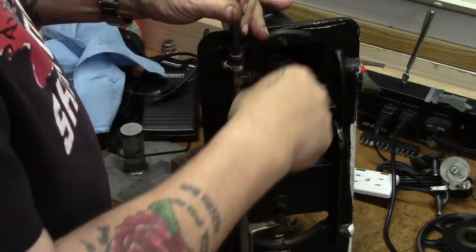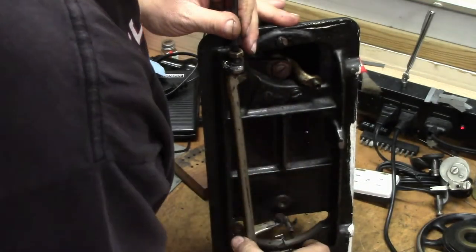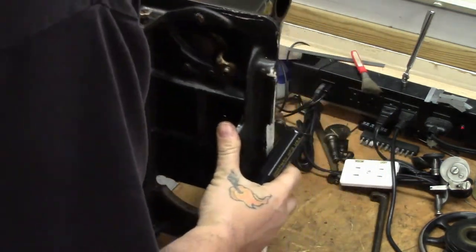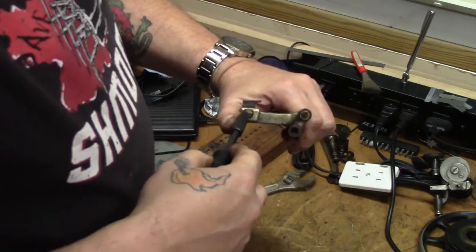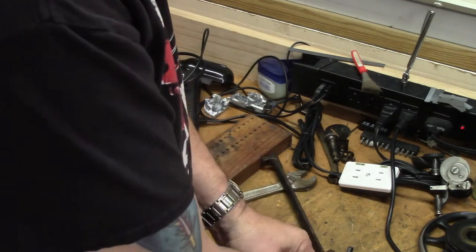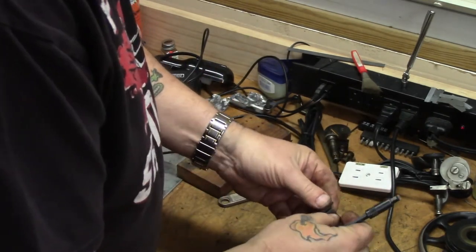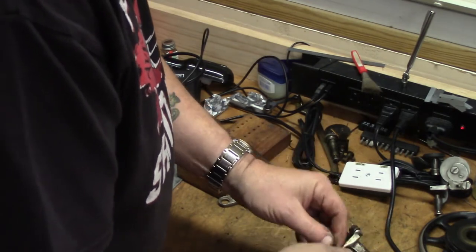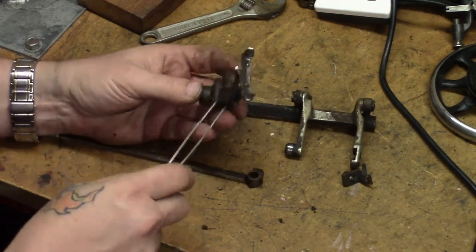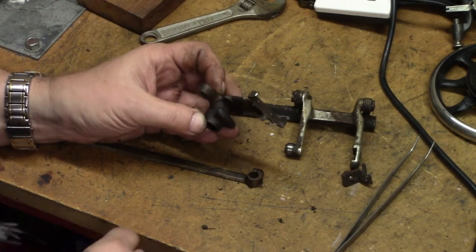There we go - came off with the feed dogs; I should have taken those off first. We'll take the feed dogs off. Wow - these feed dogs are actually glued practically in place, they're gross. Everything here is gross. This is the shuttle carrier on its Pitman and the pivots - it is pretty disgusting. Let me grab a Q-tip to give you an idea of how disgusting this is - just a couple little passes and you can see how much crud is coming off.